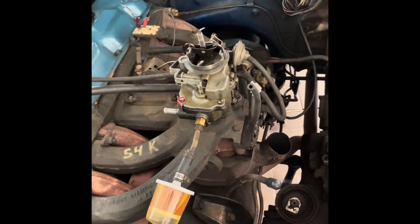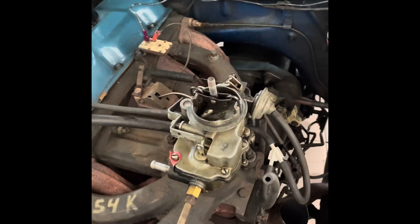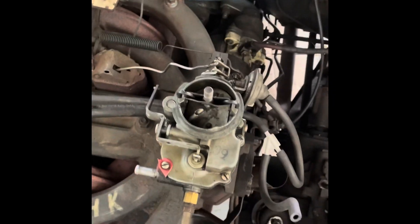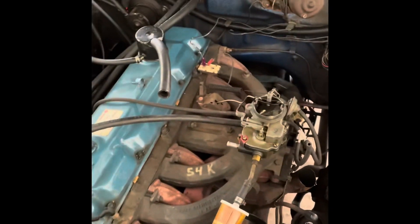You want that connected. It has nothing to do with emissions — don't disconnect it thinking you're gaining horsepower, because you're not. The engine is designed for a reason. It needs the right temperature air. Again, 95 to 105 degrees is ideal per the Chrysler engineers, to properly atomize the fuel. Make sure that's hooked up: use manifold vacuum to one side and the other side goes to the diaphragm. Make sure the pipe is connected to the stovepipe so it can get hot air. The engine will start and run better — it does make a difference. If the choke, fast idle cam, and this system are all set up right, you should have no problem starting and running properly.